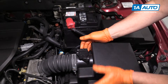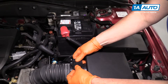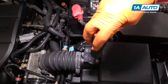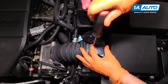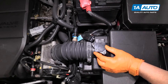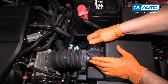A nice dry seal is fine because it's plastic, not metal. I'm just going to mount it down. You cannot mount it the wrong way — if I went like this, the holes don't line up. It's nice and easy, self-explanatory. Press down — I felt it move right in. Now I'm going to remount it with the two Phillips head screws. I'm not going to snug that down tight yet until both are in. Now I'm going to reinstall the connector. Make sure that the orange seal is still in there — that's the moisture barrier, water seal — and I'm just going to line it right up and click it on.